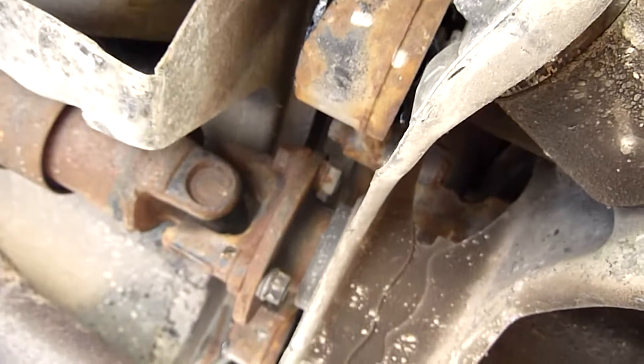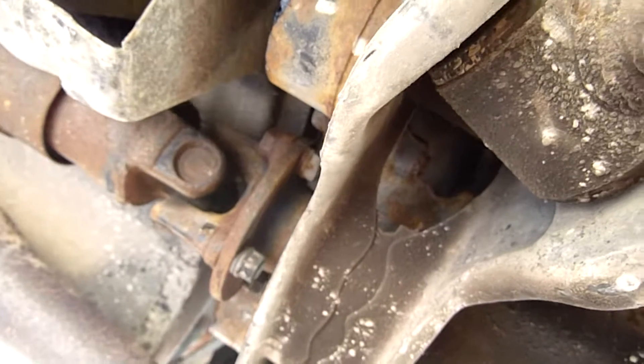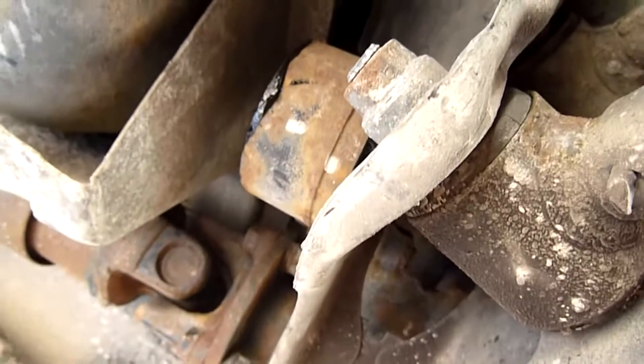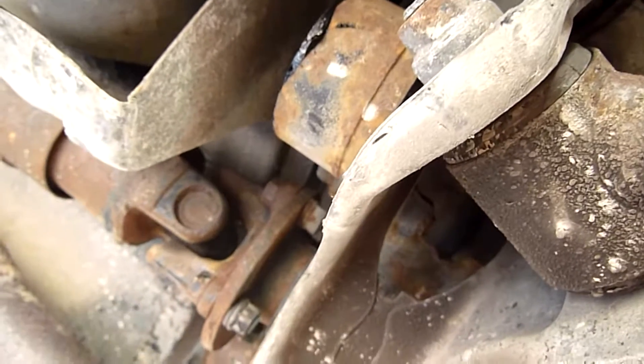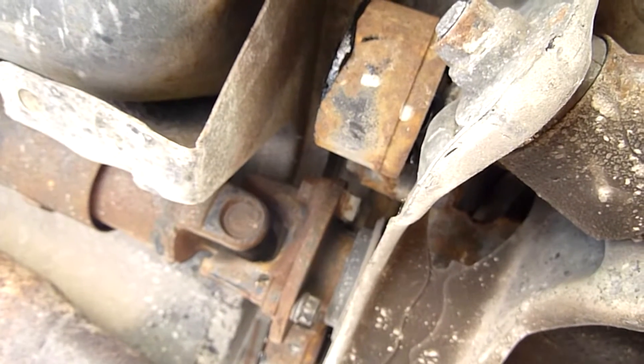Interesting to see how well this works. I'm not going to touch the rear one, I'll leave that as it is, but the front ones were definitely getting a bit haggard. Definitely not as bad as some of the cases I've seen - there's a video on YouTube of one guy doing it where you can see the diff going clunk, clunk, clunk against the housing. That's not good. But this one here, definitely an improvement. I know that force does have to go somewhere, but because I'm using a urethane sealant instead of hard plastic bushes - originally I was thinking hard plastic, but no, that's too hard. You want something that flexes but not something too soft; these were always too soft. We'll see how it goes. Thanks for watching - I'll do a bit of an update in the comments or the description based on how it goes tomorrow or the next day, whenever I get around to swapping cars around.